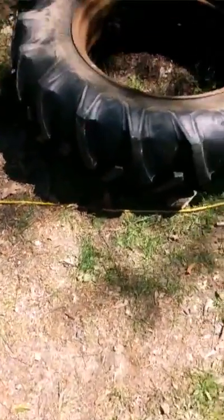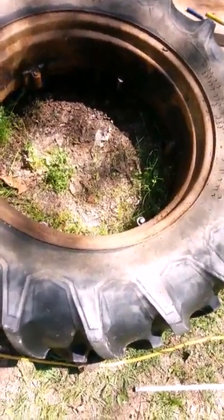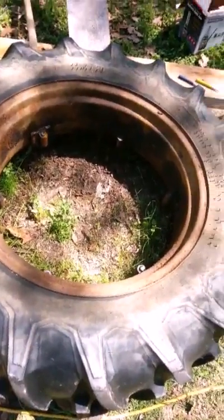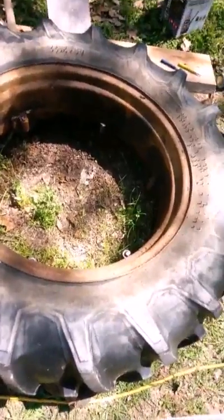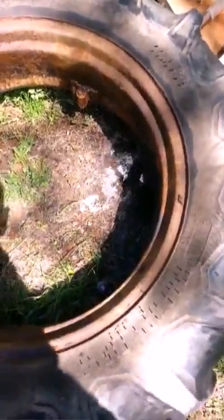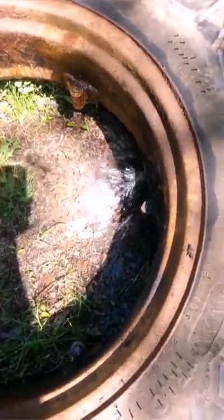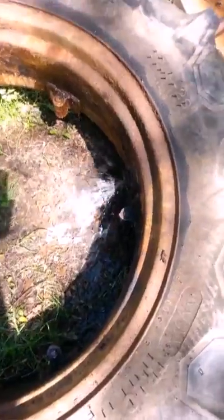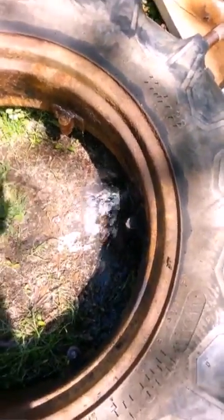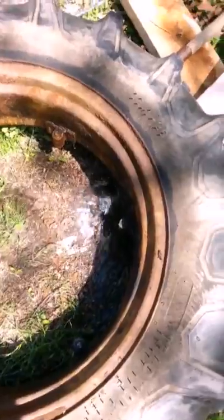The reason I took the hub out is because I let the tire go down on the ground to drain. I think the valve probably clogged and didn't drain all the way, because I could no longer lift the tire. So I'm gonna see if breaking the valve off gets it to drain more, because it seems to be too heavy for me to manage right now. The valve stem had gotten clogged, so I'm still loaded with calcium chloride. I just cut through the valve stem and I'm trying to get the liquid out of there so I can actually lift the tire. I was trying to break the bead, and it seemed like it was holding pressure and wasn't giving in, and that's because it was still holding pressure. So I gotta let this drain a while.